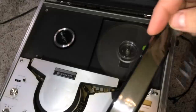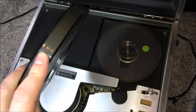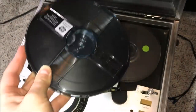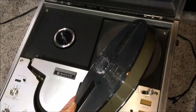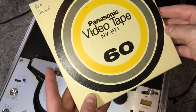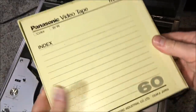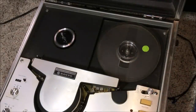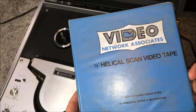The absolute joy of finding a machine like this and finding the tapes for it is finding these tapes that are very much like VCR tape — very much like your standard VHS tape. However, these older tapes get what's called sticky tape syndrome. Professionals like my friend Tom who works for a broadcasting station will take these and bake them — actually put them in an oven for a certain amount of time to make the tape usable again. Here is a Panasonic NVP-71, labeled as a 60-minute tape, but it's got a Sony videotape inside. Blank tape — used probably for industrial purposes, schools, businesses.